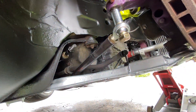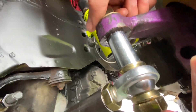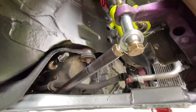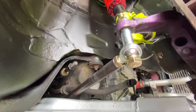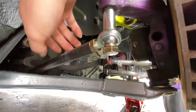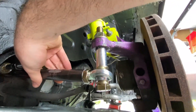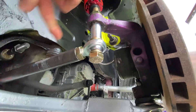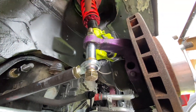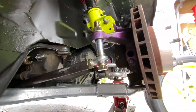I used the electric drill to drill this hole out to 5/8. I'm getting it threaded in - just hand tight so I can see where it's going to fall. This is how it's going to look in here. With the bump steer drop spacer, when this is all hooked up the tie rod will be level - a lot better than the crazy upward angle it used to be at when compressed.